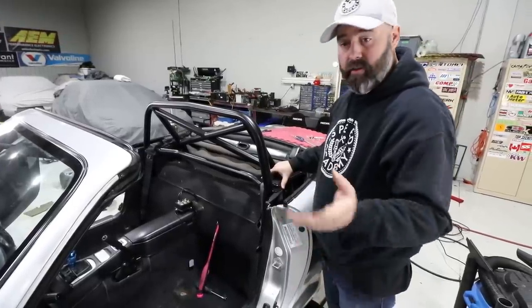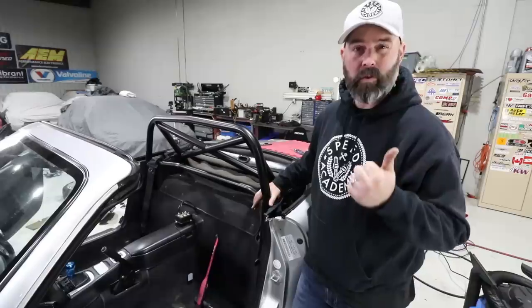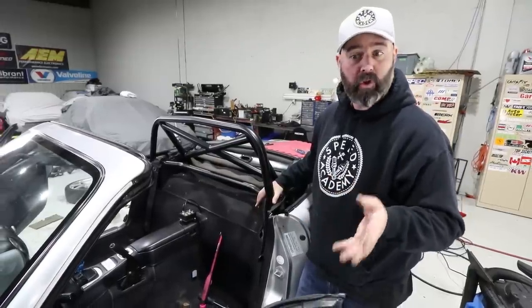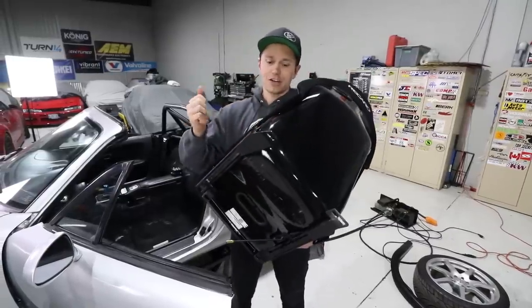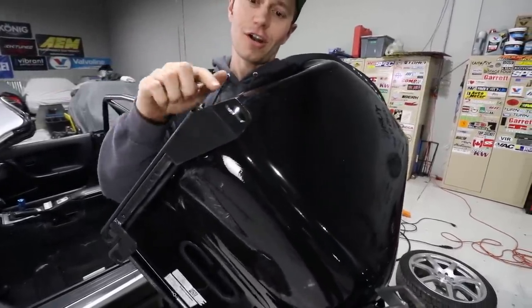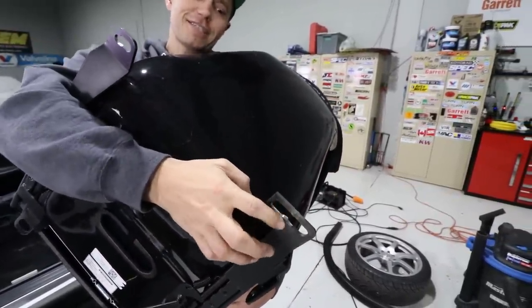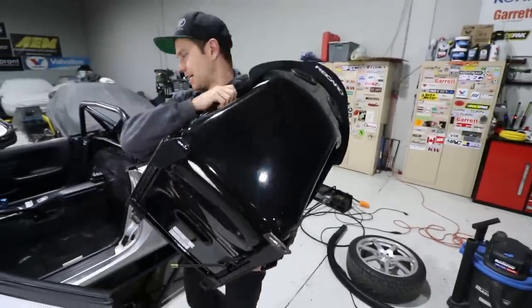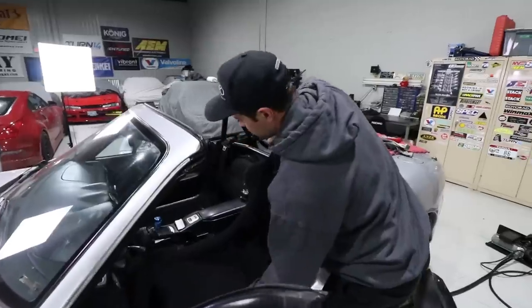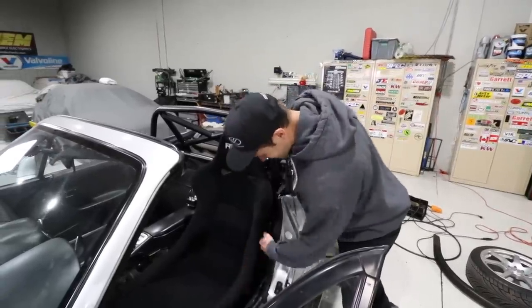Now we're going to put the seats in and have a look at those door bars. I had a quick chat with Grant from GC Fabrications and he mentioned that those door bars are confirmed to work with Sparco Sprint seats and some other smaller seats, but he was unsure how they would fit with the Recaro Pole Positions which are a little bit bigger. So we're not confident they're going to fit but we'll try. Before dropping our Recaro seat back into the car, I went ahead and did some modifications to the seat rails to try to get the seat to move more inboard, because we were having problems with it hitting the door card. I sectioned out a bit of the mount on this side to make sure we can move the seat as far over as we can — it may give us just enough room where we don't have to cut the door card, and it'll give us a nicer seating position anyway.